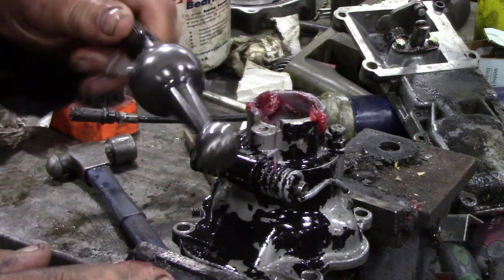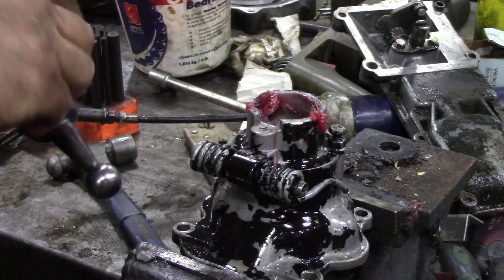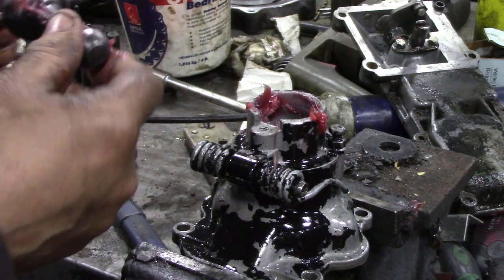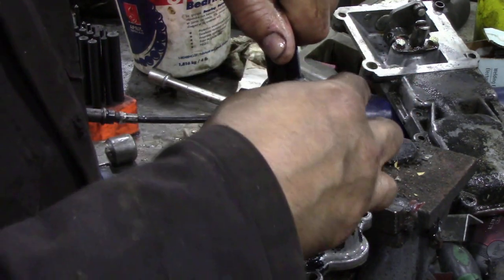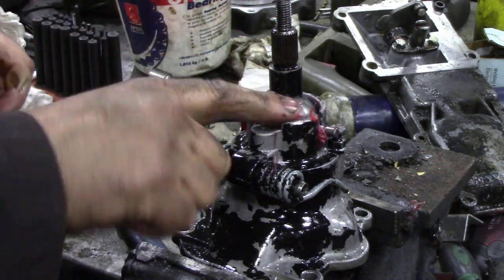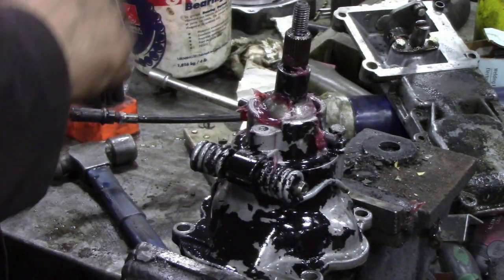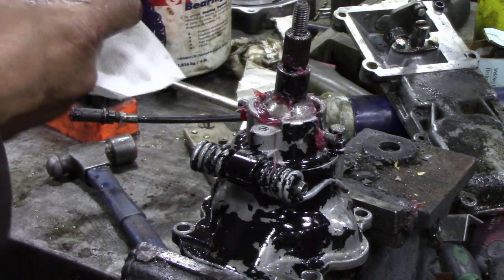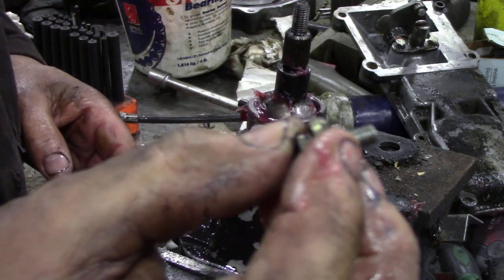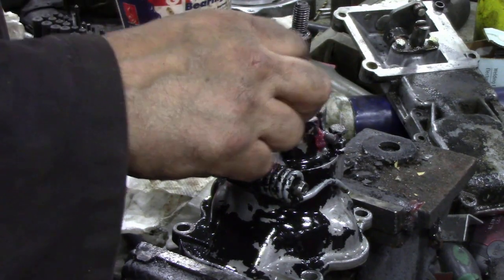All nicely cleaned up. Grease up the ball - it doesn't matter which way around this goes, it's the same. Oh no it does, because you've got to put this little plunger in the back, so the little plunger goes towards the bolt. Put that in - there we go, a bit more grease on. There we go, and now we can put the ball back in. Now this has got a very special washer on it - it's got two rounded sides so you can't put it on upside down, but you can't just put any old flat washer on it.